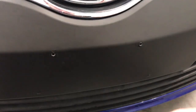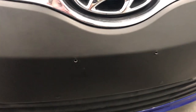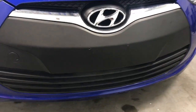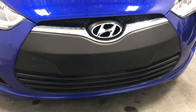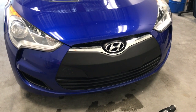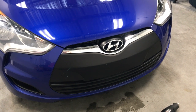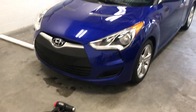With a little knife I trim the inner holes for the license plate. Some people don't trim them — they just put the screw in — but I expect it to go in cleanly. Sometimes it works, sometimes it doesn't; sometimes it'll start rippling the film and it just looks bad. Take two seconds and cut those out — don't be lazy. Wipe it down with spray wax or alcohol to clean it up and get rid of any grease from your fingers. And there you go — that is how you wrap that piece on a Veloster. I recommend no car washes for about a week to let those edges really settle in. If you have sun outside, park it in front of the sun. Thanks for joining me on this video — like, share, subscribe, give me a thumbs up if you liked it. See you on the next one.